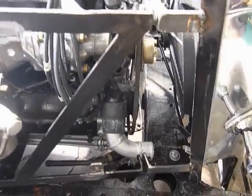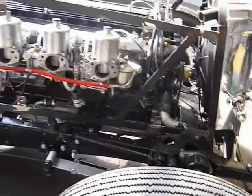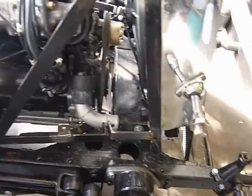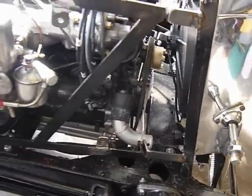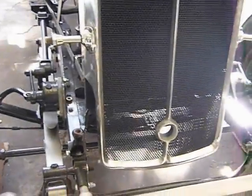Had to do a bit of a modification to the bottom and top pipes because the outlets are a bit closer now, so we have to go at a tighter radius. The front suspension I think is all right as it stands, because the weight on the front of the car is much the same as it was.